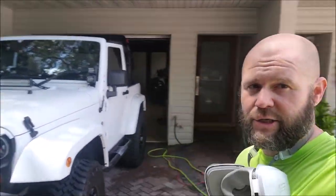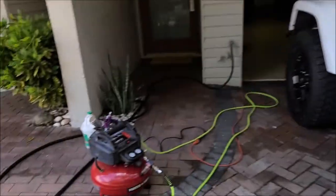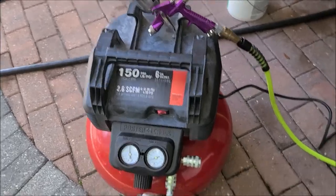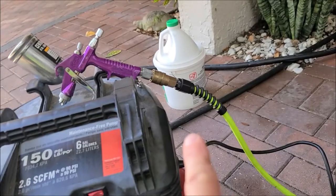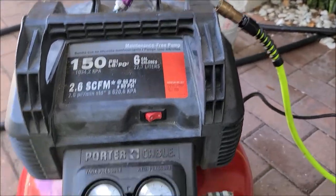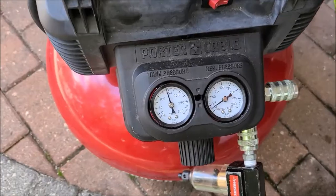I just got started with the Super 7 coating on this Jeep Wrangler. Behind me I have my air injection system — this is a Porter Cable pancake compressor, it works awesome. My second regulator that I usually have at the gun is leaking and not working properly. So unfortunately I only have the one. I would normally put this on 80 PSI and run that one at 40, but I'm running this one at around 40.